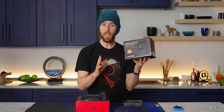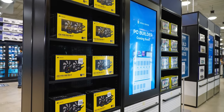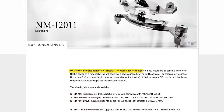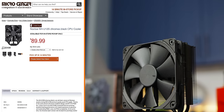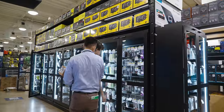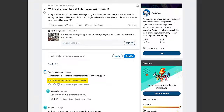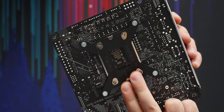Now for the CPU heatsink. The LGA 1700 socket is still pretty new, so any cooler that's been sitting on the shelf for a year might not include the right hardware. But if you reach out to Noctua with proof of purchase, they will send you a free mounting kit — this is a potential extra step in our foolproof PC, but thankfully this kit makes it impossible to screw up your mount. We went with the NH-U12S for its excellent performance, compatibility, and ease of use. It's also available at Micro Center. Another solid option the community likes is the Scythe Mugen 5 Rev-B. Pick up your motherboard with one hand by the IO shield and push the backplate into place through these holes — it's symmetrical, so the only thing that really matters is that the holes correspond to where the screws are sticking through the socket.